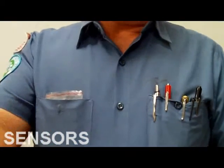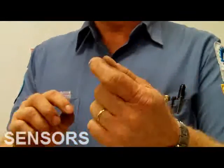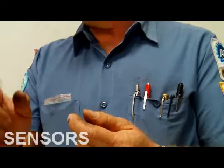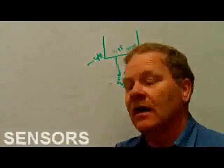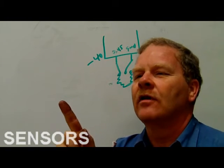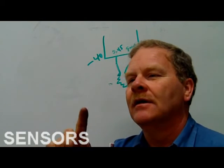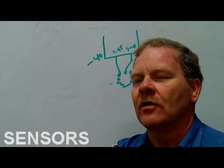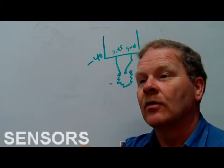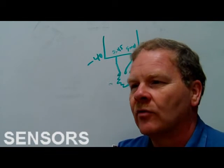Now think about this. With that one there, you could check a fuel gauge. Hook it up between the ground and the fuel gauge, and you dial that thing, switch the key off and on so it'll correct quickly. You can get your fuel gauge reading. If it says in your book, 11 ohms is empty, 145 ohms is full, you can go halfway between 11 and 145, and you've got half tank. So if you're checking your fuel gauge, you unplug it, and it goes to full. Short it together, it goes to empty. Hook your little thing in there, and you can dial it wherever you want it to go. Remember, though, because of your slosh module circuitry, you're going to have to switch the key off and back on for it to correct quickly.